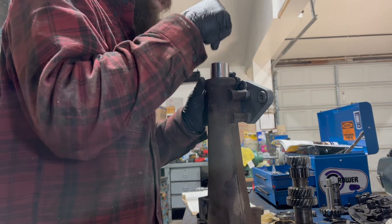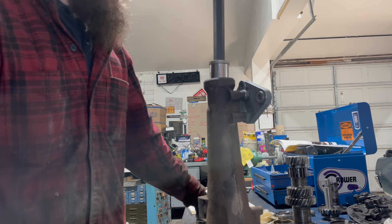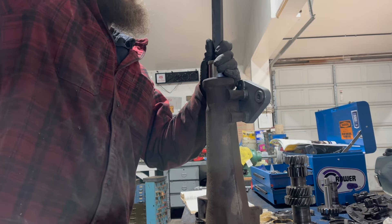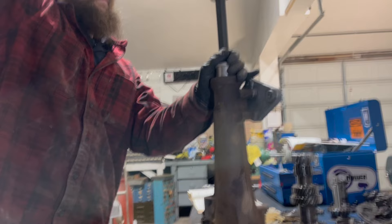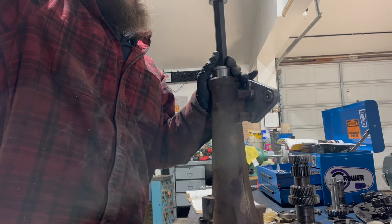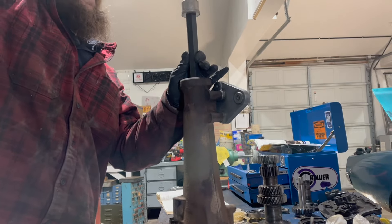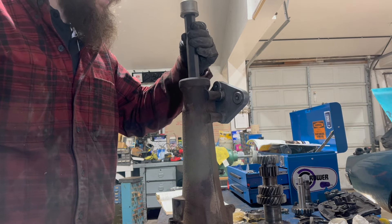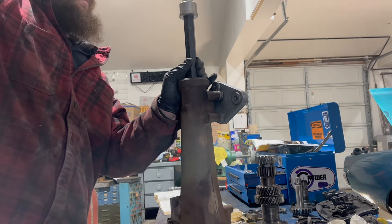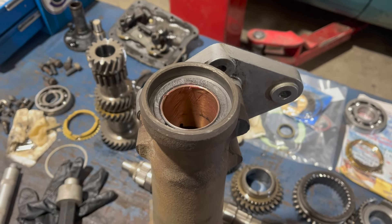This new bushing has little notches - they go inward. You can definitely use something else to do this, but if you're not careful you're going to goober the end. Much better with the right hammer. Still perfectly aligned. You'll know it's there when this wide edge hits the case and stops. This is probably overkill, but I went ahead and greased the inside bore of the bushing too.